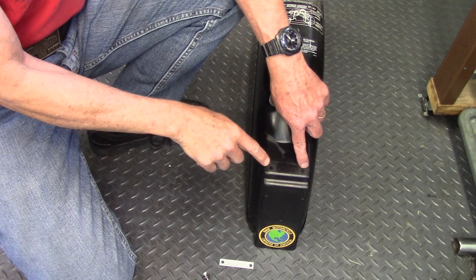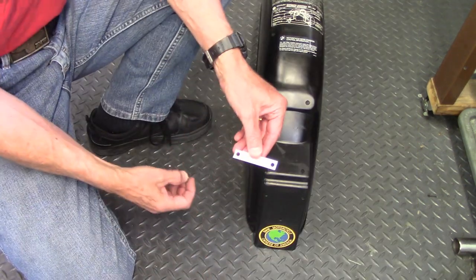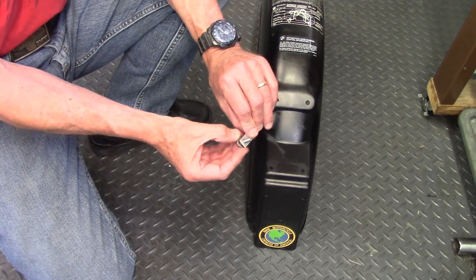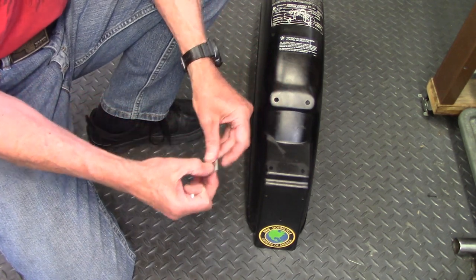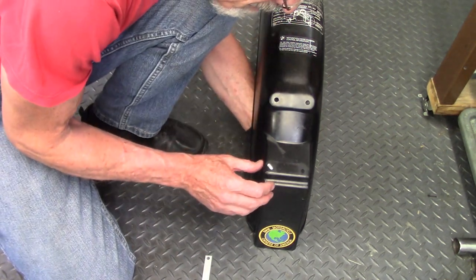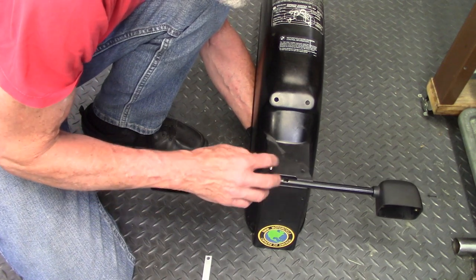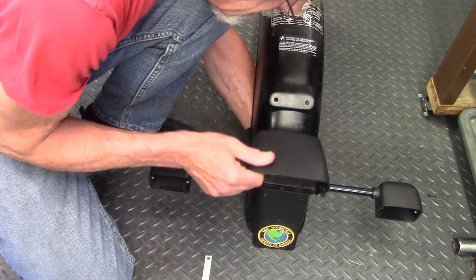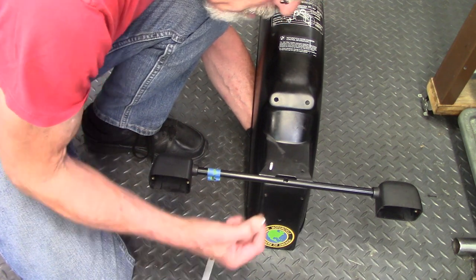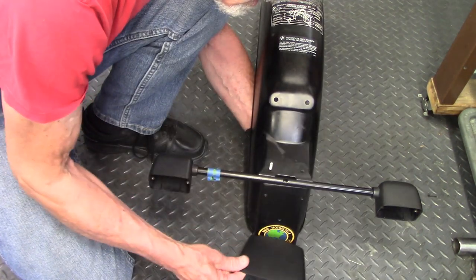At the very end of the fender is where the tail light and turn signal bracket mount. The mounting system is the same — a metal plate inside the fender and a hex bolt with a flat washer coming up from the bottom. The hex bolt for the tail light and turn signal assembly is the same length as the one for the front. However, it's a slightly different mounting system on top: there's no rubber grommet. The turn signal bracket slides over, then the tail light slides over that, and inside there's a wave washer and a regular nut that attach through the tail light assembly to hold everything together.